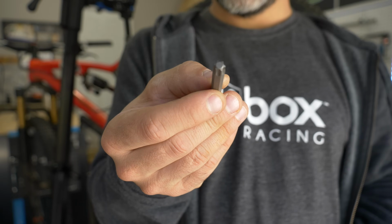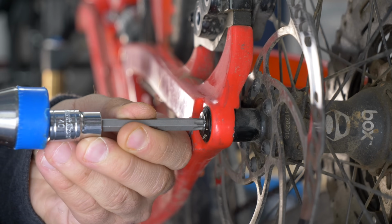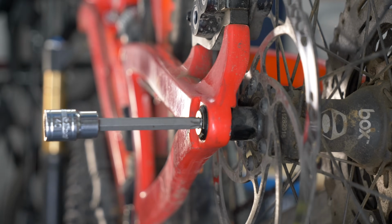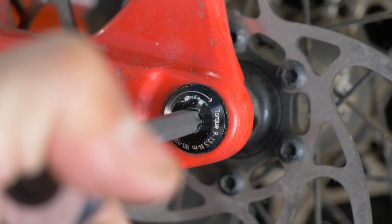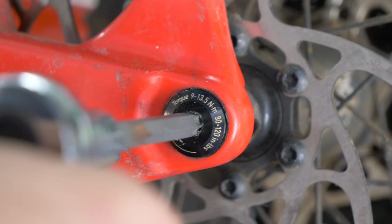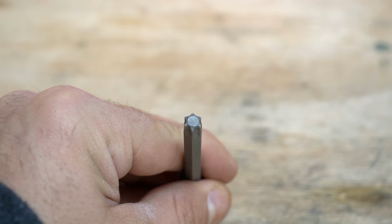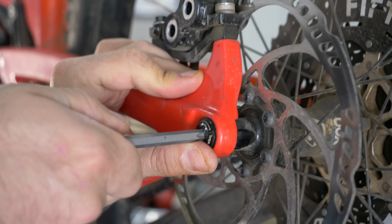Find a Torx bit that's just a little bigger than the mangled hole you've created. Carefully tap it into the hole until it's hopelessly jammed in there. Now see if you can crack it loose. By the way, there's very little chance you're going to damage your Torx bit this way since it's made of steel and your Thruaxle is made of soft aluminum.